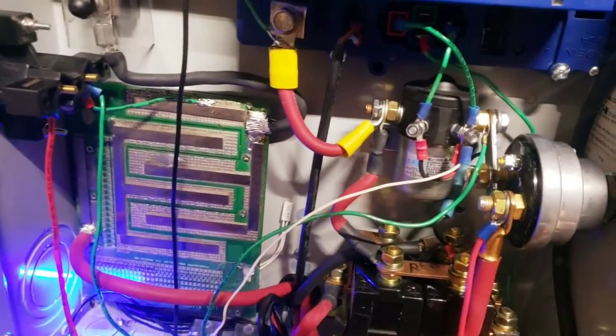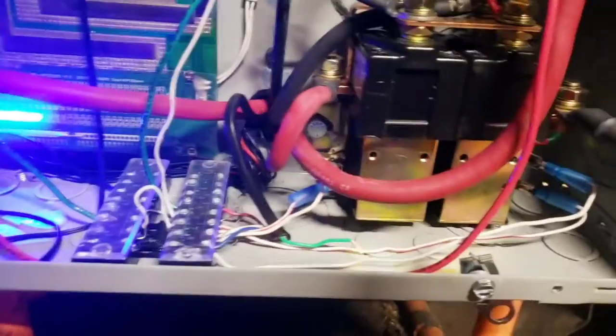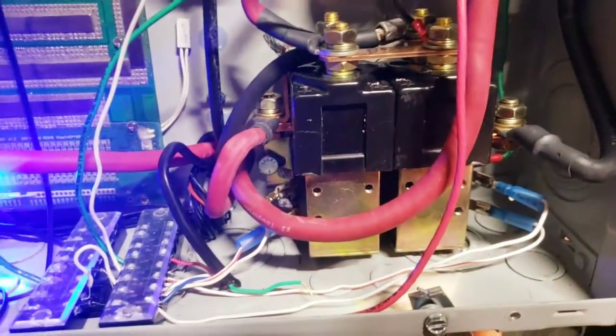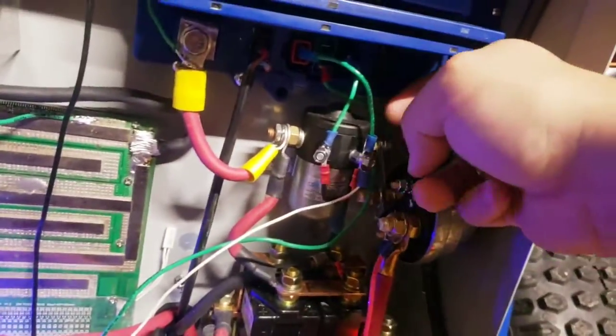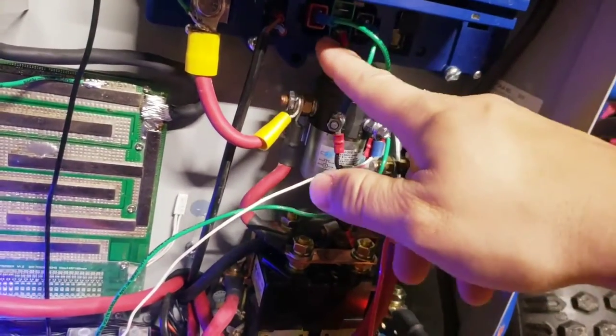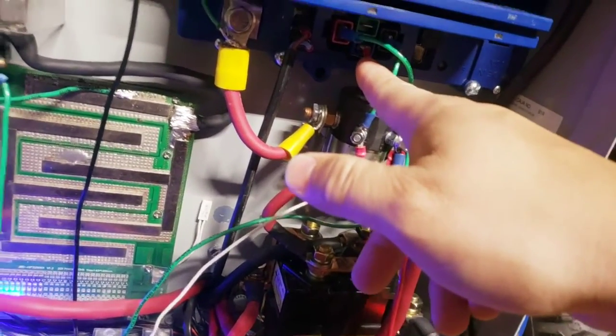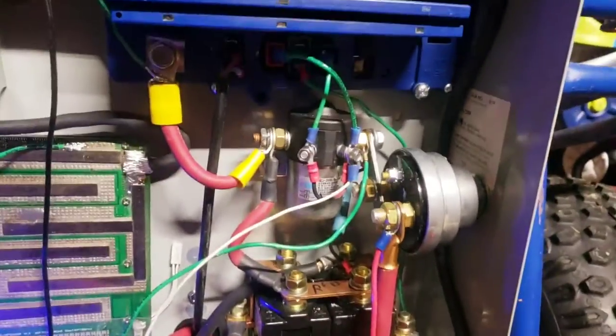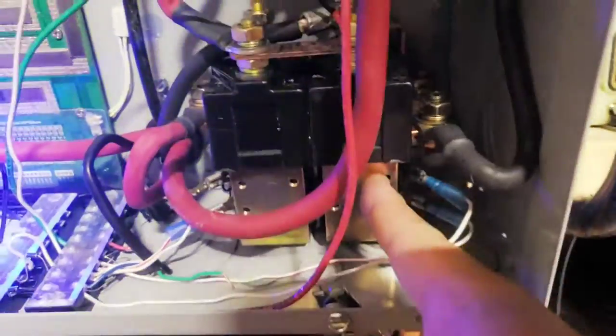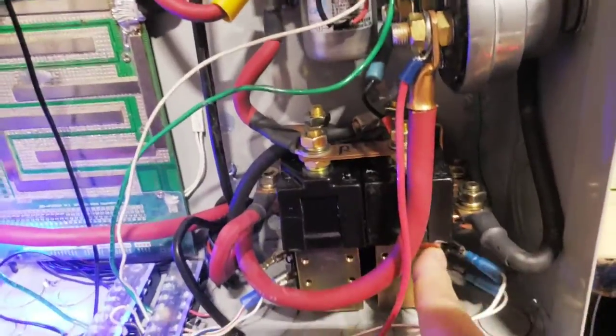I do have a feeling I wired something incorrectly. I really thought I had it right, but when I pushed down the throttle pedal it felt like it was going about half speed — which would make sense if I was in reverse, but I was in forward. From my understanding of how this unit works, there's a blue signal cable here that tells it to run at 50 percent. If I'm wrong, then this is my forward solenoid and this is my reverse solenoid, and I have it wired so that forward runs at 50 percent and reverse runs at 100 percent power.